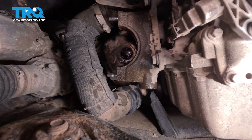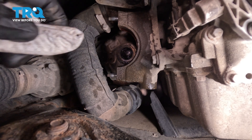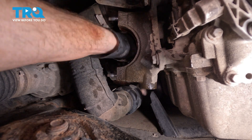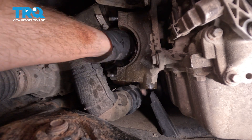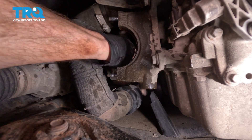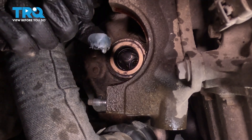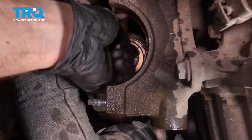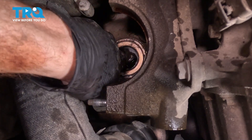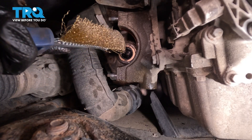While you have the axle out of position, the next thing we need to do is clean and inspect that oil seal — you can see it deep down inside there. When inspecting this, we want to make sure it's soft and pliable and does not have any miscellaneous debris. Once the area is clean, we'll continue on with some petroleum jelly as a lubricant. Using a wire brush, we're just going to clean the mounting bracket here.